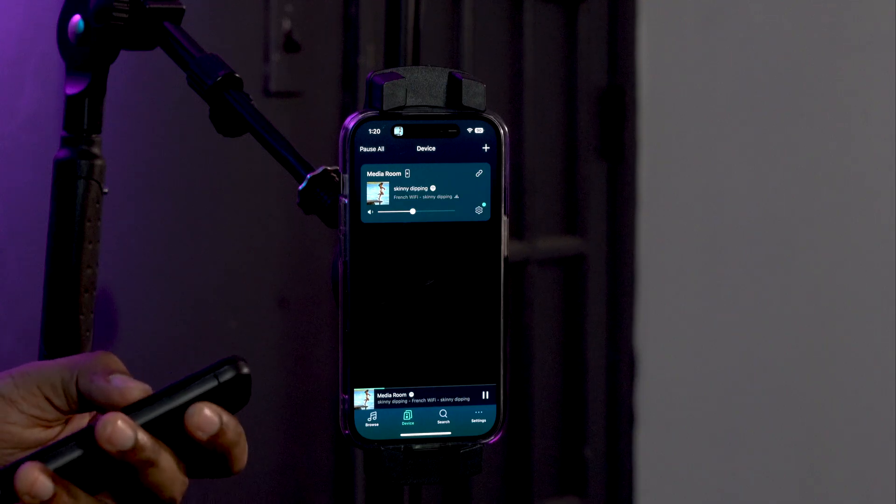One thing to make sure is to check the PCM settings on your TV — you want it outputting through PCM and optical, otherwise you might not get sound through your whole system. So that's three ways you can control content: from your phone, from the capacitive buttons on the device, or from the remote we already set up. I can press play, raise or lower the volume — and you can see that when I lower it on the remote it's also lowering it in the app and through my soundbar. I can pause music, skip to the next song, go back, mute it, and select through different sources such as Wi-Fi, Bluetooth, or a device connected through the line inputs.